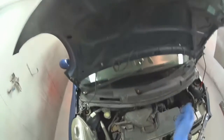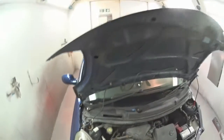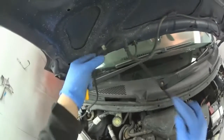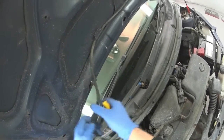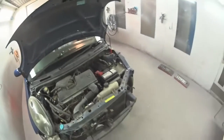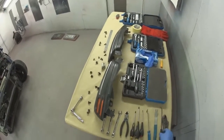A lot of people use a little hot air gun, or they struggle along with brute force. I'm confident there's no fuel — I've got a reasonable sense of smell, I've been doing it a long time, and I'm happy to use this just to warm that end up. It literally only needs a little waft and there we go — that's separated nice and easily. Again, do not use a naked flame if you think there's a hint of fuel; struggle on or find another way. That's just an old-fashioned cheat you can use if you're confident.